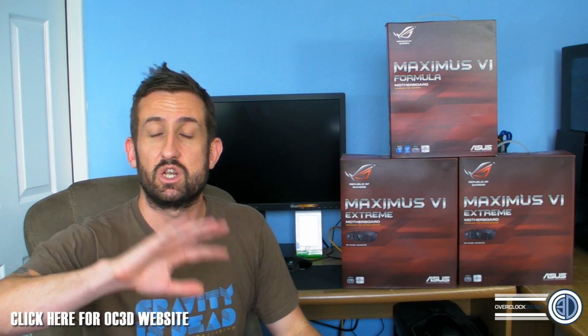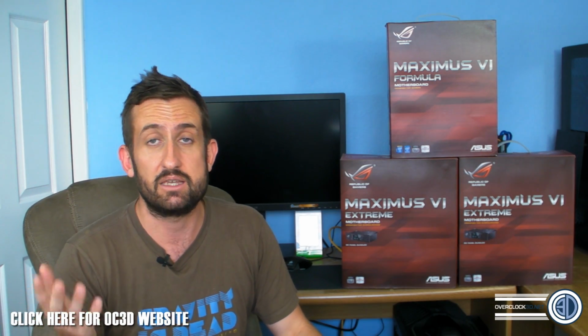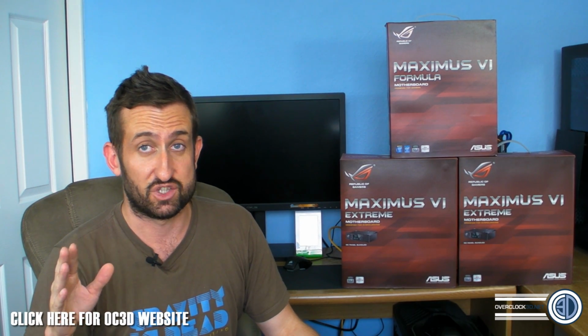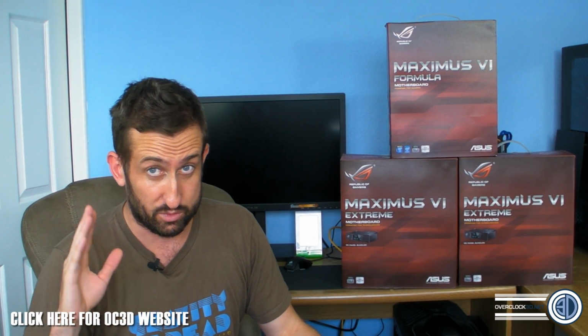If you don't want to look inside your case, you just want your rig to work, I would say save your money, get one of the cheaper motherboards. As long as it's reasonable quality, then I would go with that and put in whatever you're capable of, your overclocking prowess, or whether you just want to run it at stock. Just bear in mind, if you run it at stock, you can undervolt it and it'll still work, and you'll get lower temperatures. But essentially, if you're not fussed about looks, and you just want it to work, with the cheap end motherboard you'll get the same kind of performance as someone that spent 3 times as much.